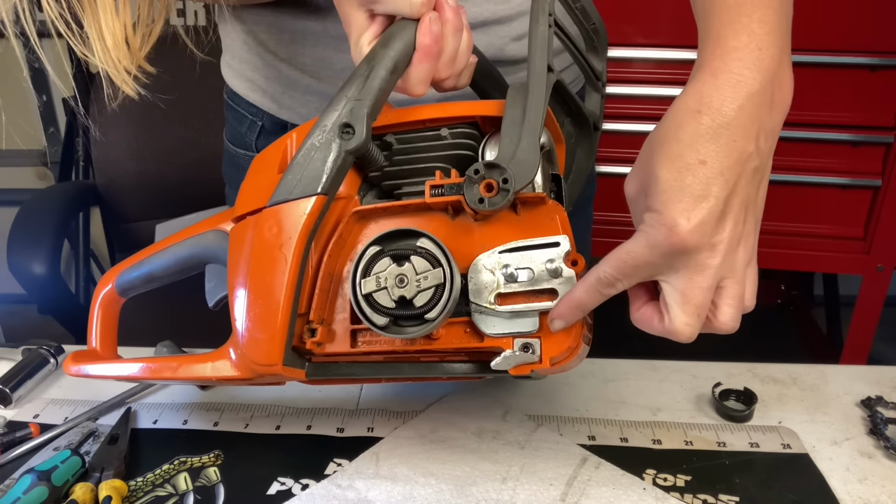So what did my experiment prove? It proved that all chainsaws are going to leak a little bit. Why? Because while they're running, they're throwing tons of bar oil up into the clutch cover around the sprocket, and it's just, as you saw, creating a huge puddle as it's sitting there. So there's still a bunch of residual oil stuck up in there when you leave it back in your case when you're done with it, or you set it in your garage.